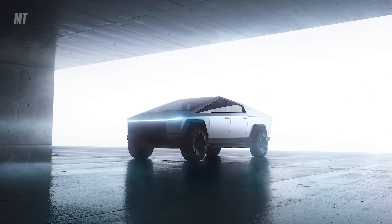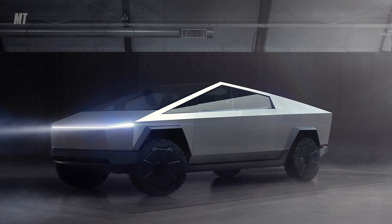This all is sort of a prelude to the next drivetrain coming down the line — one motor up front and two in the back. It's what has been doing laps around the Nürburgring recently, developing a high-performance version of the Model S, but it's the upcoming high-performance drivetrain. I wonder personally if they're going to be close together — I think Rivian did that. They pack the motors close together along the centerline so that the half shafts can be as long as possible and suspension arms as long as possible for wheel travel. I suspect Tesla is doing the same thing with the plaid drivetrain, future-proofing it for the upcoming powertrain.